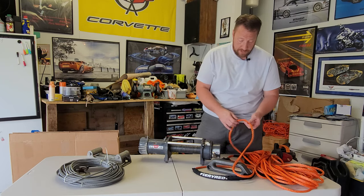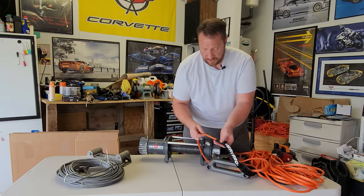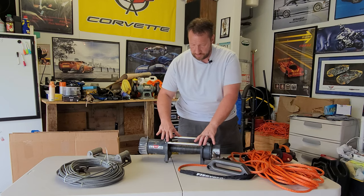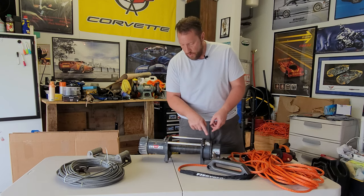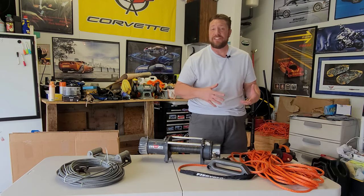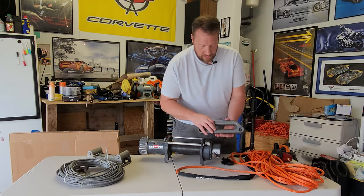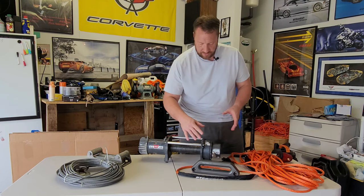So the rope itself seems to me to be very high quality. The end of the rope has what I believe is about a five-foot-long sheath that covers the end of it. This will keep it protected against any mud or debris. When you spool the rope up onto the winch and it's running across the spool, most of the rope is sort of protected by itself - one roll across and then the next one covers that, and the next one covers that. So most of the length of this rope is actually protected by itself. This last five feet or so should be about the last winding on top, and then the portion that actually comes out and sits outside the fair lead - this is kind of exposed. There are a couple of holes on the bumper so that you can access all of these different parts.